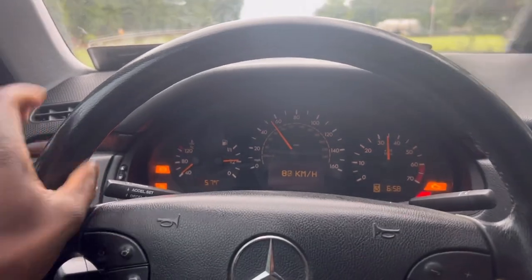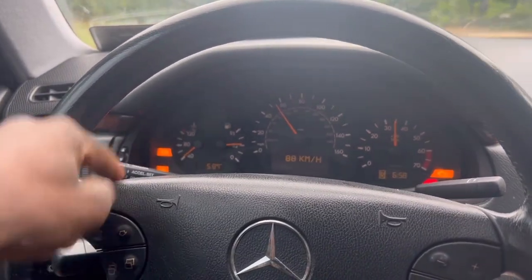I know when I make a stop I'm going to recheck. We do have the issue with the coolant temp which is not reading and staying at 40, which I know is very inaccurate after driving for a good bit. We got Christmas tree lights and look at my temp gauge. I already read the code off the computer and it was indicating the coolant temp sensor. So I'm going around auto parts stores — the one that has it is like 40-50 minutes away, but I'm already going to one.